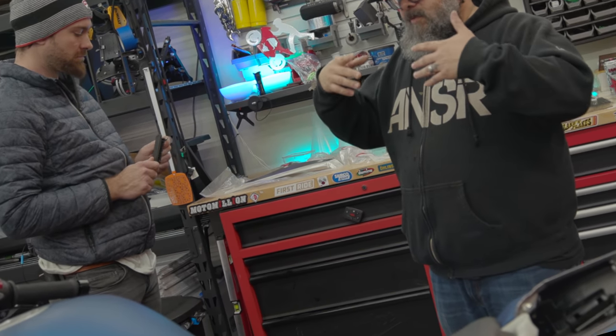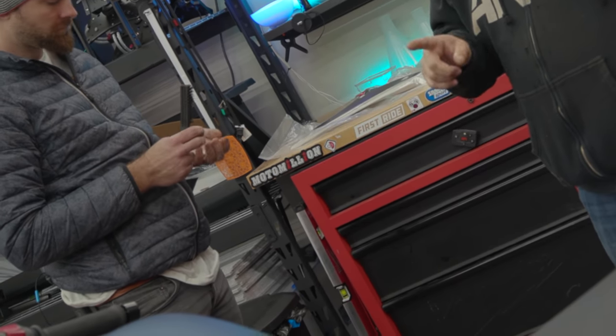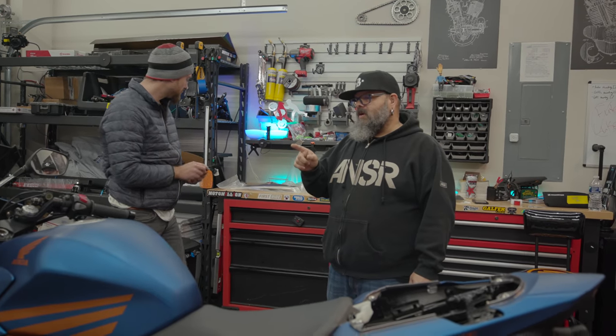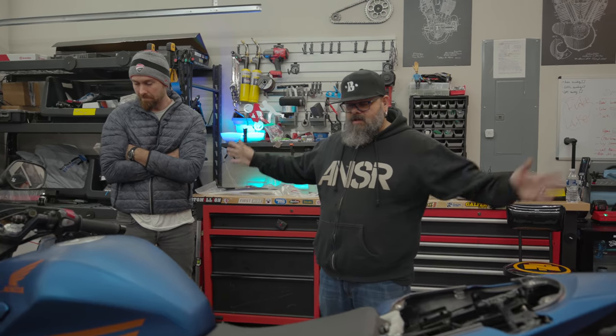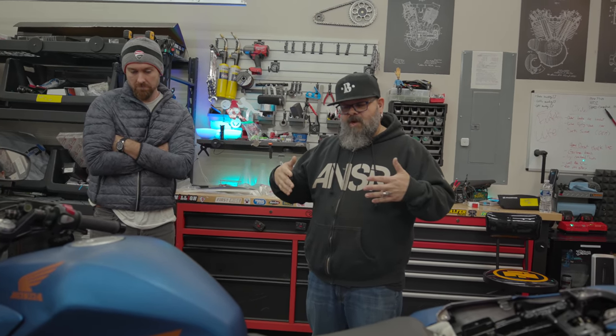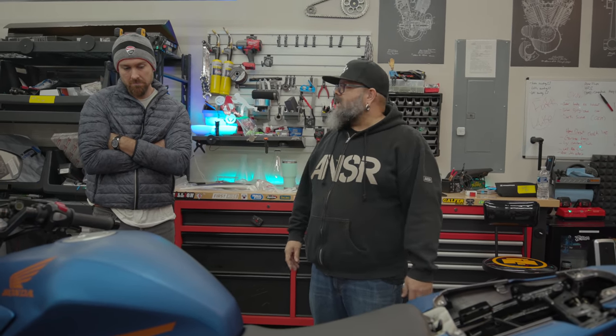We can put those fairings back on. Then before we put the lower fairings on, we need to jack the bike up so we can pull the front wheel out so we can put the front fender on without damaging it. And then front wheel goes back on, heat shield goes on, side fairings for the bottom go on, foot pegs get rebuilt, and we are complete.